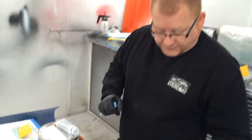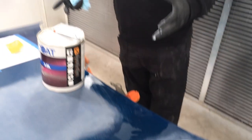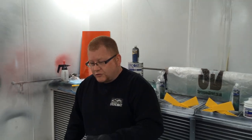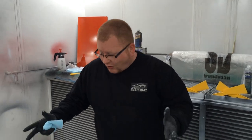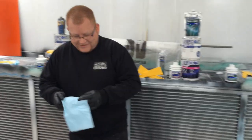We'll be able to start removing the initial layer in seven to eight minutes. For a good application onto clear coat substrate, I'd recommend starting with 120 grit - you don't need to go any coarser than that. There's the clear coat right there - 180 abraded and we're down to it. You'll come across a lot of original finishes in the shop, but there are a few layers on that bonnet. Happy days - let it cure and we'll get back and look at something else.